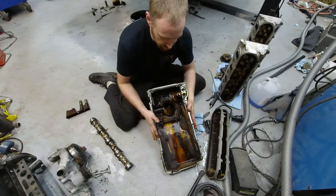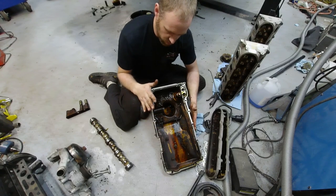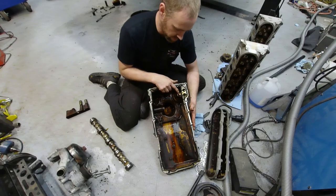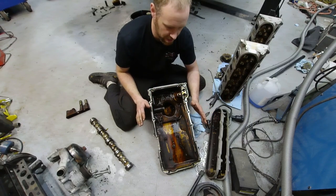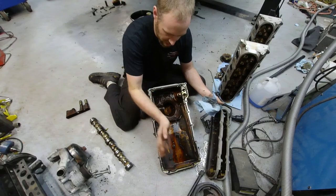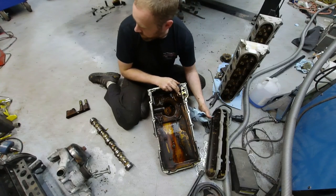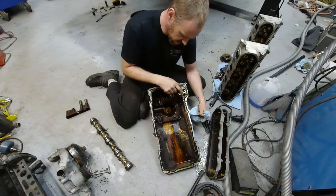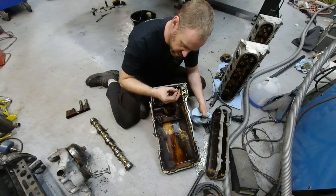Now let's get to oil pressure and oil pan scenarios. There's a pressure relief valve on this oil pan. A lot of motors have it but not all of them. Why GM put one here is beyond me since there's already a pressure relief valve built into the oil pump. But this thing needs to be taken care of — there's a spring and a ball in here and they get stuck, so you want to make sure you address it and clean it up.